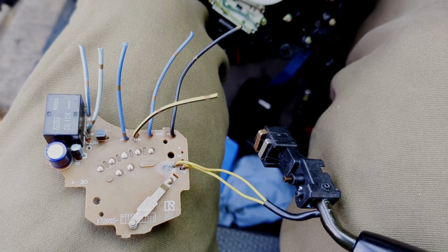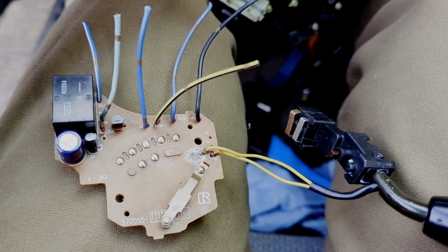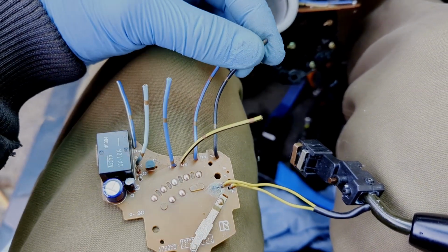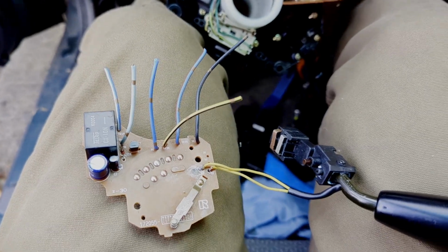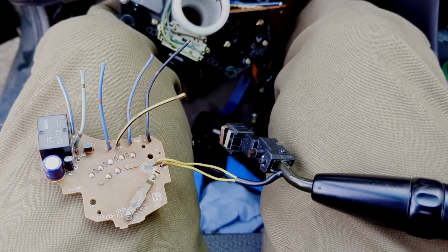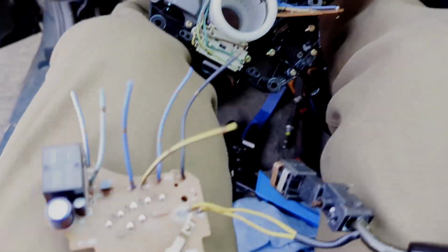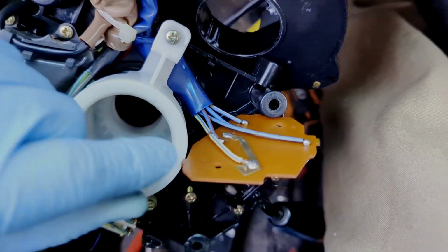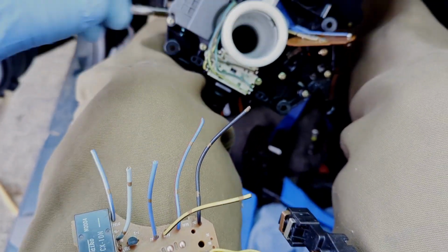The Suzuki Esteem intermittent wiper board has an extra wire that the Metro doesn't have. If you have the intermittent already, I think there's a 1 setting intermittent option on something like the LSI Metro. You might have this ground wire, but I do not. So I have a basic one. Look how basic this board is. Not even any circuitry. So I gotta run a ground wire for this extra wire.